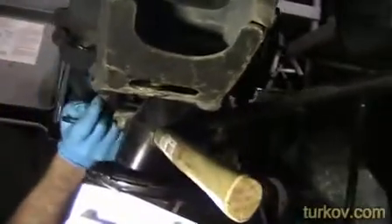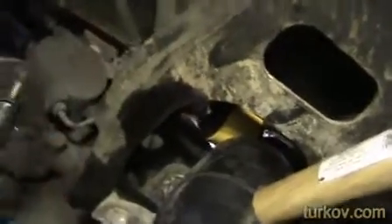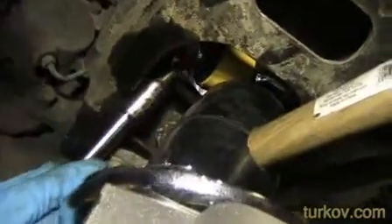Now the fun part — you've got to compress the shock and fasten it back down with these bolts. What we've done here is basically use this mallet on top of this floor jack to get that shock to compress. If you look under here, those bolts we removed — we've got to put them back in now. Once everything's aligned, you should be able to just stick them in right here. We'll start screwing stuff in.